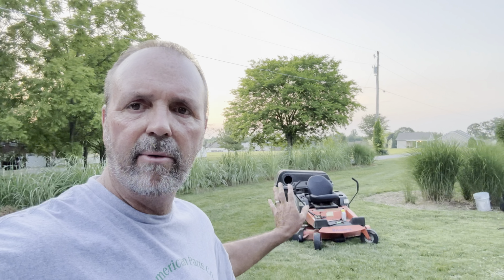If you got that one, that's probably a 2007 or 2008 model Husqvarna. That's the worst one I ever did. I put deck belts on all the time, and they're not that hard. But that's how you do it. And remember, the tip is the V part of the belt goes into the V pulley. If you don't know what the routing is, just Google it from the serial number of your mower first, or just look on the deck. It should be on there, and it shouldn't be this hard. You saw how tight that one was.